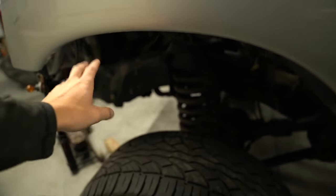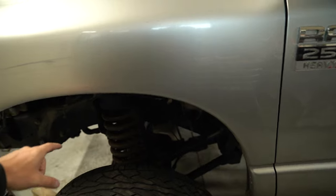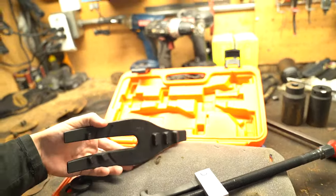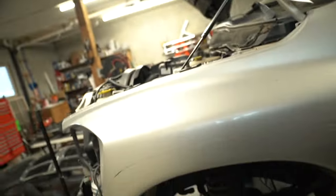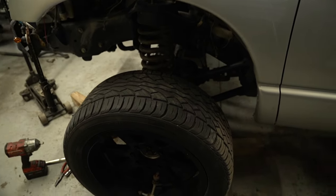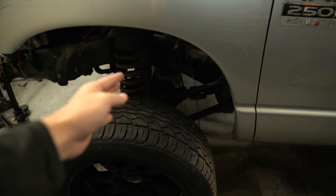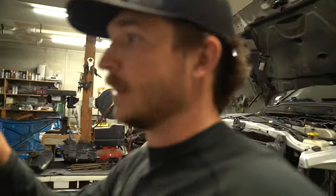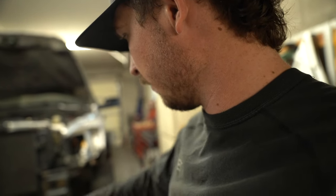but we got the remainder of the steering stuff off. The steering arms and stuff are still there, and the control arms, the springs are still in here. We tried last night, but we didn't have a spring compressor tool, so we went to AutoZone, grabbed this special little unit. Hopefully it's strong enough to handle these springs, but we're gonna try and get the springs out and then set it down, because as you can see, 6-inch lift, these are aftermarket control arms, and the axle sits kind of closer to the cab than it did to the bumper. So I'm hoping we can take these out, keep these control arms, and the axle won't be too far forward, and we can still reuse these. I wouldn't mind a little bit forward, so then I don't have to worry about hitting the cab with the wheels and tires. But we're gonna try and get these springs out, and then I think everything for the Megacab is almost off. Get the control arms off, and then I gotta figure out what I'm gonna do steering wise.